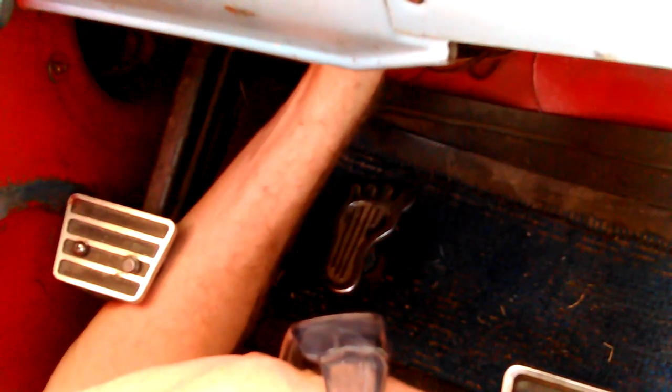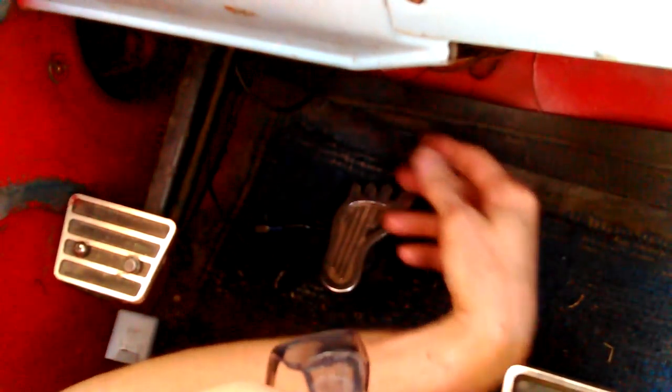Oh, that's not the jumper. That was the, where is it? Yeah, I'll put them in there and use them as handles to hold on to them with, maybe. And then I'll mash the horn button. There. If they fit. If they're too wide, then they won't go in there. Well, they look like they're the same width as the male connectors on the relay, so maybe they'll go in there. Okay, that one went. As long as my jumper wire will stay.